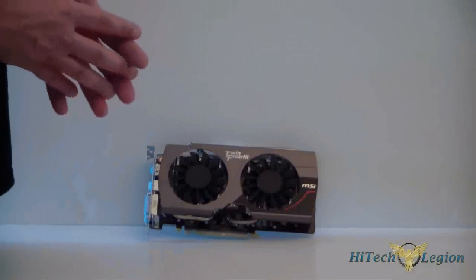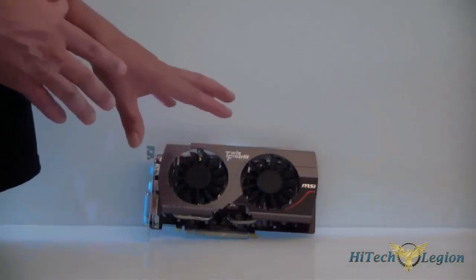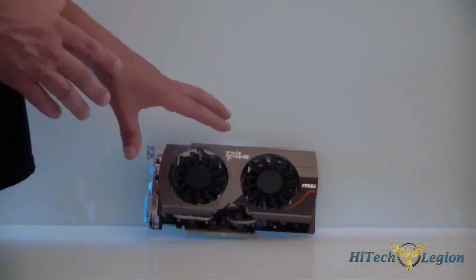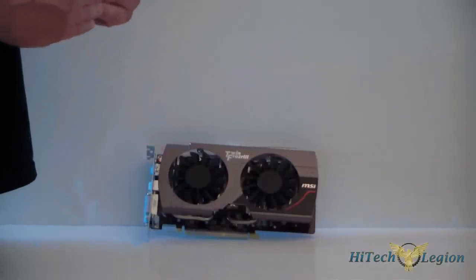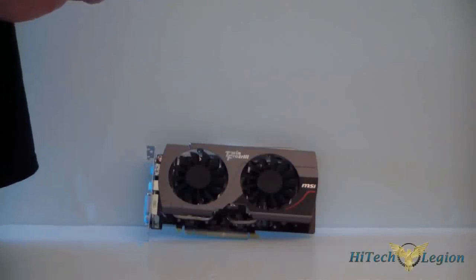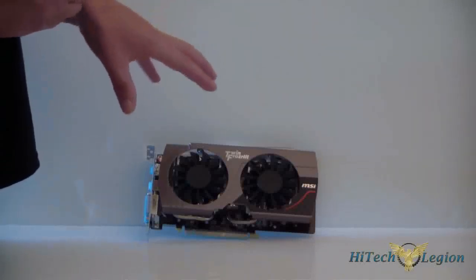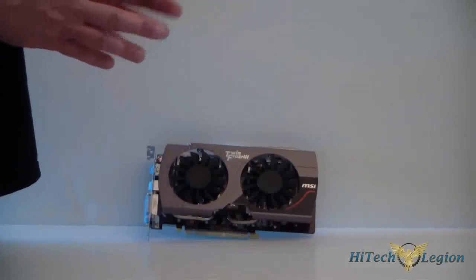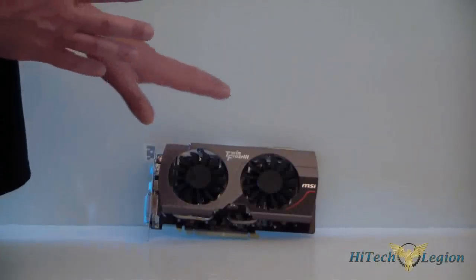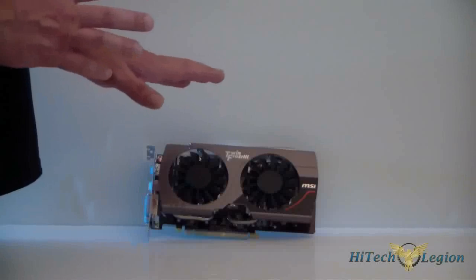It has a 192-bit bus and GPU Boost. What I've seen with this card is it maintains the boost because it keeps the temperatures where they need to be. With my overclocking I was able to get a constant 1267 MHz and saw peaks to 1280 MHz. Compared to the reference design and the EVGA Superclock we also tested, this card required a lot lower fan speeds and only hit 60 degrees Celsius, where the EVGA went over 70 at around 64% fan speed. This card stayed at about 43 to 45% fan speed and idles at about 27 degrees Celsius.